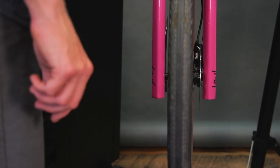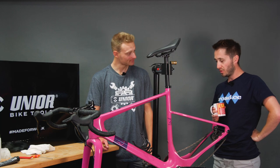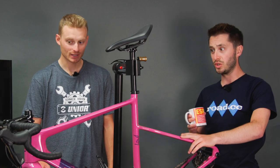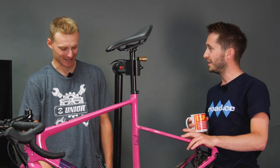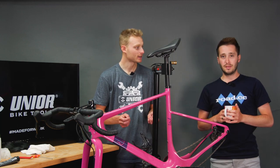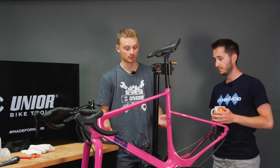That's the common stuff taken care of and hopefully your disc brakes are now running quietly. Now we're going to take a look at bleeding our brakes. This bike came directly from Europe for review and has Euro brakes, meaning the front brake is on Jamie's left hand — which has nearly caused a few crashes. If you want to swap your brakes around, it's actually a quite simple job. The only thing is you will need a specialist bleed kit — they do not mix and match, so if you've got SRAM get one for SRAM, Shimano get one for Shimano. This is important because it threads into the calipers and shifters and helps avoid mess.